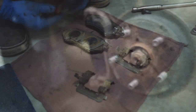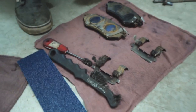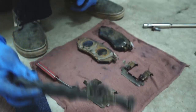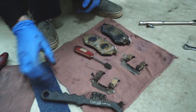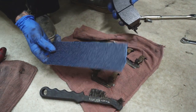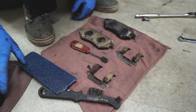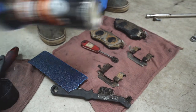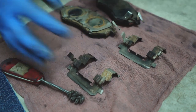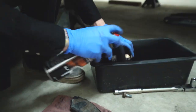It's best to find a kit that works for you. I like to have a bigger coarse brush and a small one for getting into small areas. This is the 40 grit sandpaper I'll be using to resurface the glazing, and we'll put everything back together with some ceramic brake lube. I spray some brake cleaner on the channels first to get the dirt and rust loosened up.